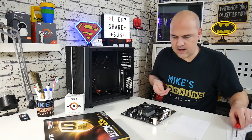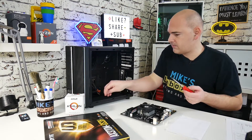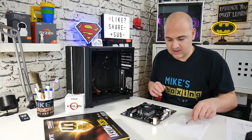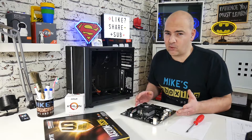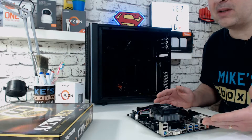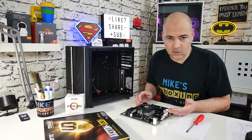There's the motherboard out of the chassis. Try and put the screws back where you got them from so you don't lose them. Do take a lot of care when removing the motherboard, because any damage you do to the board — any physical damage, bent pins, all that kind of stuff — if you send the board back with bent pins, chances are they're going to say it's user error or damage that didn't come from the factory, which will invalidate your warranty.